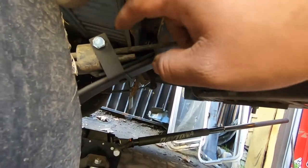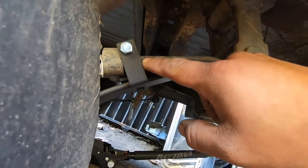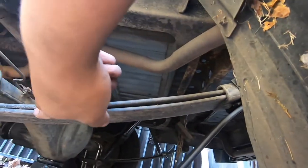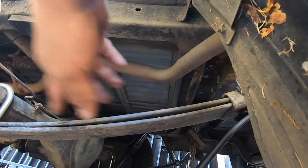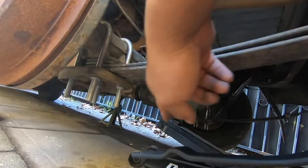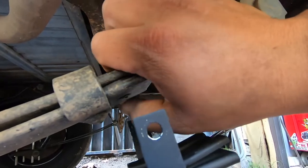We've got it in here and have to put it all the way back. This little pad is going to be riding on the edge of the leaf spring because we don't want it to hit all the way to the leaf spring perch. We also have a rivet right here that holds this pack in place. These leaf springs are good with no weight, really good, but since we have the camper — they are 3-inch drop leaf springs so they're not going to be the same as stock. Now we have to put the U-bolt through. We ran into a little issue: that rivet is preventing the white pad from sitting on the leaf spring.